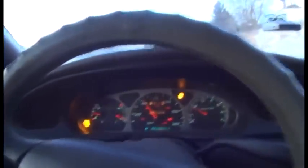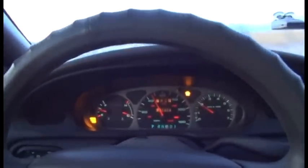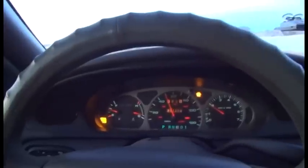Got that water pump in, and the temp gauge is just climbing. I already have tremendously hot air even at idle. If you're experiencing these problems with a Ford Taurus or Mercury Sable, like 95 to 99, your heater core is probably plugged. But the biggest problem you're going to have is that water pump is either on its way out or the impellers are getting bad — like mine, where you'd have to run it up to 3000 RPM just to keep the motor from overheating. Mine gradually started getting like that, which I guess is what caused deposits that blocked the heater core. But it's a very cheap fix — probably $35 would have fixed the problem. Hope this helps.